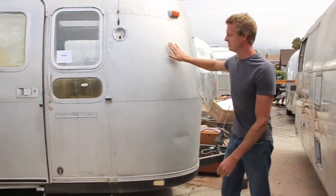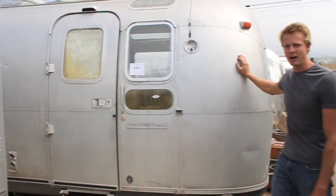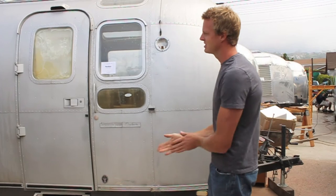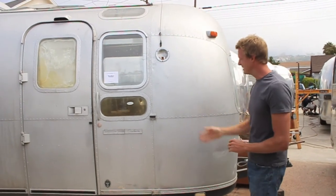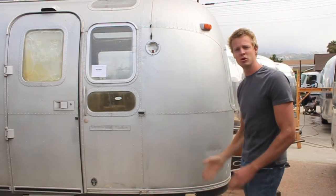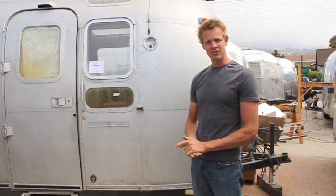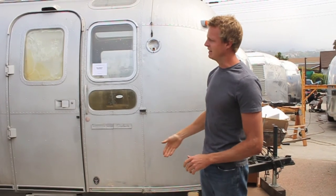This is more common than you think. It may look like just aluminum, but this has actually been painted gray — the entire trailer exterior has been painted, and this is pretty common. It's actually a good thing because removing the paint is pretty easy. You can apply a stripping compound that I'll talk about later, remove the paint, and the skin underneath has been well protected over time.